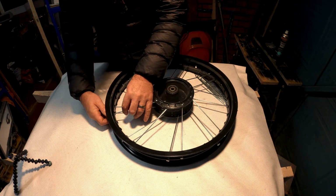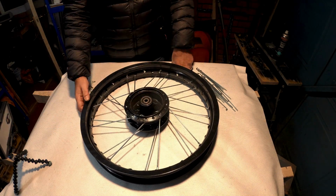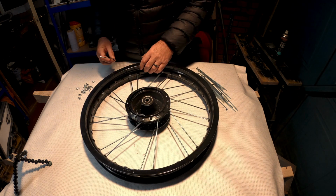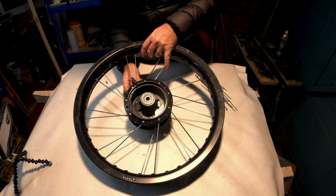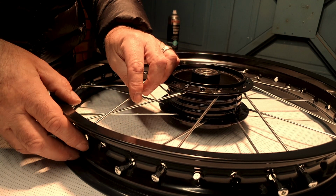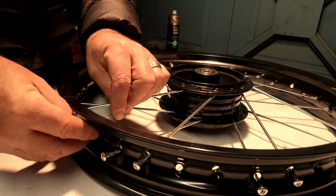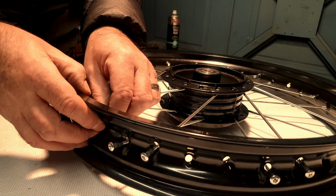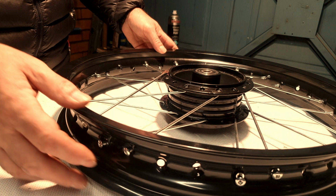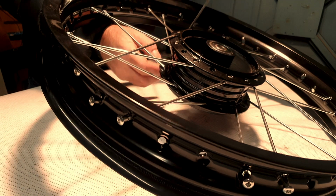And these come in from the other way. Now hopefully this will work. Well, we're going to work our way around now. We're going to go in the other way, and they're going to cross more or less at a 90-degree angle. So put a nipple in there, and lift the wheel rim up, because the wheel rim wants to sit flat on the table there. So a bit tricky. We're just going to go on our way up through there.